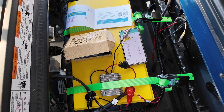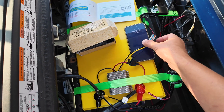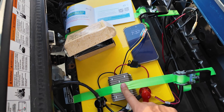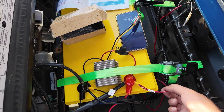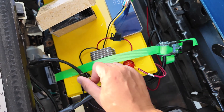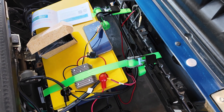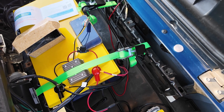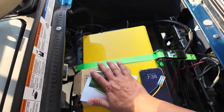Decide whether you need it or not. As for the voltage reducer, it's plugged into my golf cart's LED ground effects lights since those are only 12 to 24 volts — very important if you want to plug in items that need 12 to 24 volts. The headlights I plugged directly into the battery since they require a bit more voltage. Overall guys, super simple and easy to install. We just took it for a ride and it had no issues — it's a lot lighter, reducing a lot of weight, and it's well worth it.